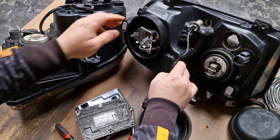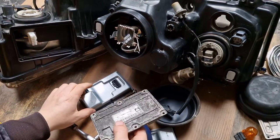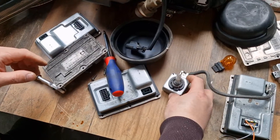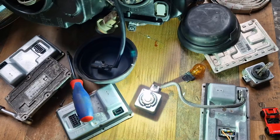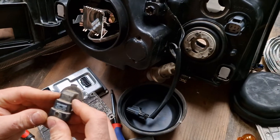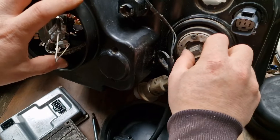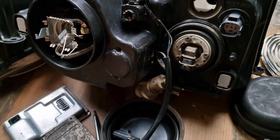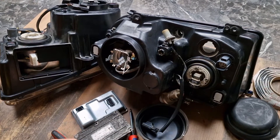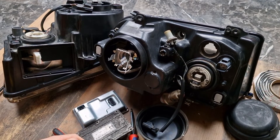If I have to summarize, both headlights are essentially the same — the only difference is their ballast units. If you have a low beam failure, you have to check the D1S type xenon bulb or your ballast unit which is located underneath the headlight. If you have a high beam failure, then you have to replace your HB3 type halogen bulb. I guess that's all for the Chrysler 300C xenon headlights. If I forgot something or if you have any questions, you can drop them down in the comment section. Thanks for watching guys, all the best, bye for now.